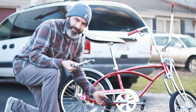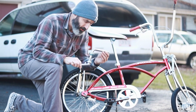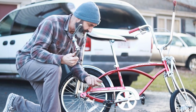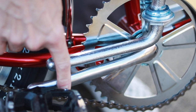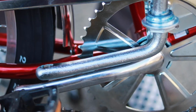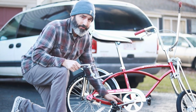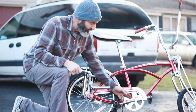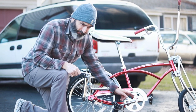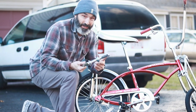One of the first things I did when I got this bike was change the crank. The stock one is a 140mm crank, and even back in the day I always used to put longer cranks on these because I liked the feel — it puts it closer to the ground when I'm pedaling. I put on a 165mm crank off an old 10-speed, and also used the bearings and the whole bottom bracket from that 10-speed because it's way better than what came on this bike new.